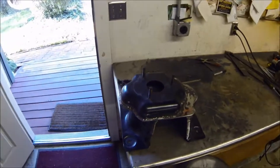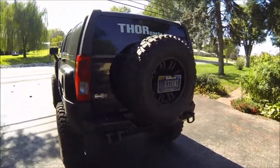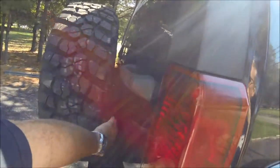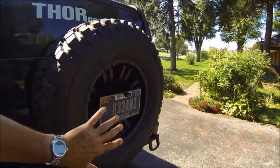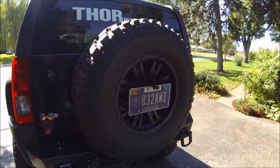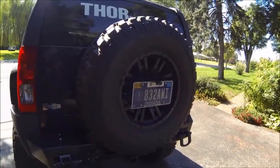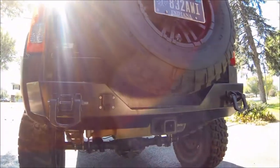We're going to throw this on here and see if I gained enough height to get a 37 on the back of my truck. Here is the finished spare tire bracket shown in place. As you can see, I am now hugging my door much like a factory one, and that's due to shortening it for the offset of the wheels. If you're running a Rancho kit you might be interested in that mod even if you wanted to leave it at the same height. Because of the 37 inch spare I raised mine, and now compared to before you can see I have room for a 37 inch. Another quick and easy mod brought to you by Thor Parts — happy wheeling!